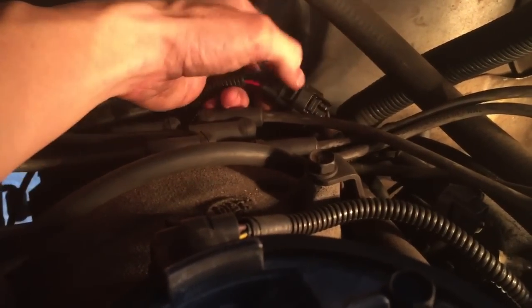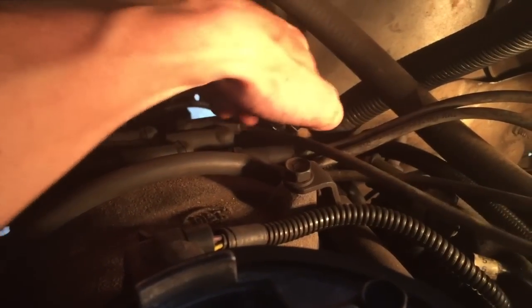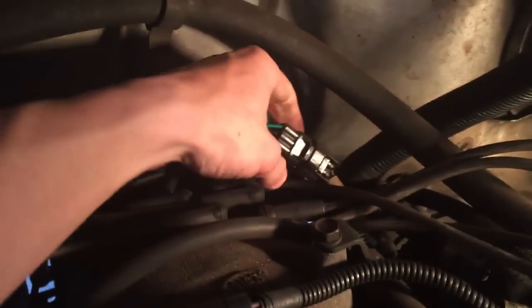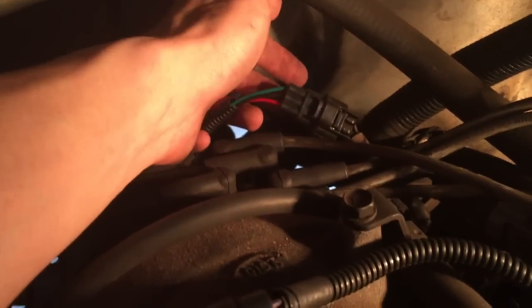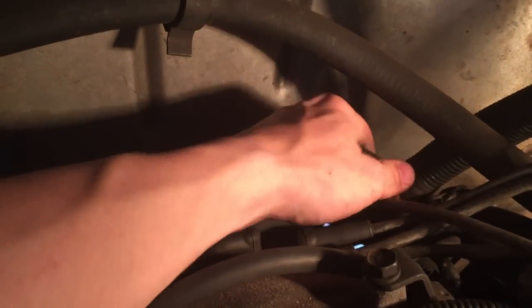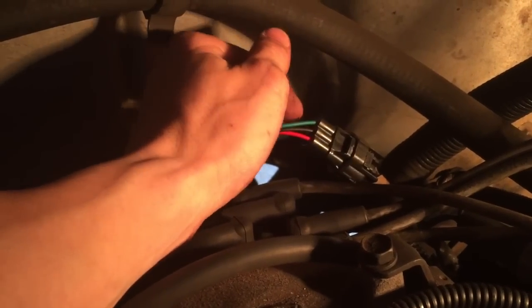To take this off, you're going to put a flathead right here. This is the new one I just put in, so I don't really want to take it out. The old one is still bolted on at the bottom — we're about to get to that in a second. All you're going to do is put a flathead in there and just pull it out. That's not going to take but a second. I just need two hands to show you, but I'm videotaping with the other one. There's the top end of the crankshaft position sensor.